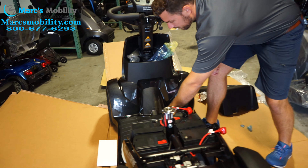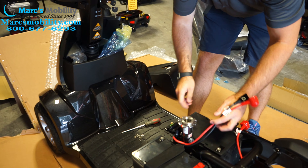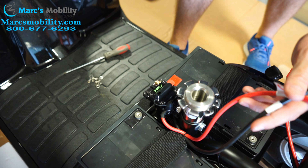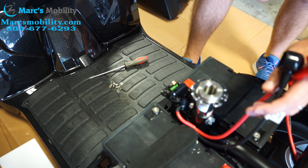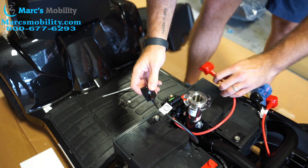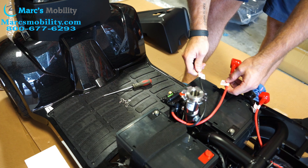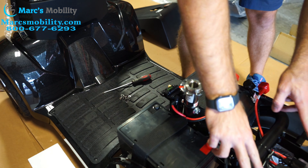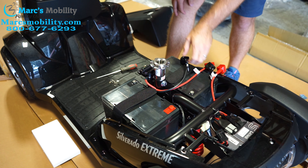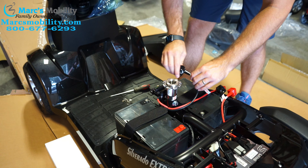For a learning experience — on any scooter that may have a relay fuse — a relay fuse is going to look something like this: two wires coming off a block. This is your 100-amp relay fuse. When you have a relay fuse with two cables coming off it, you are always going to run these cables to opposite batteries, not the same battery, because that only pushes 12 volts. Every unit is a 24-volt system. You're going to cross the batteries, or sync them, to produce 24 volts.